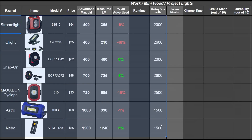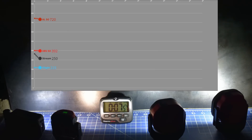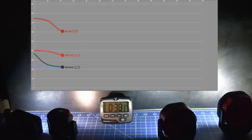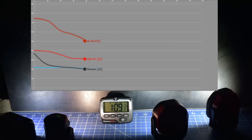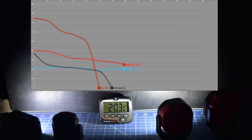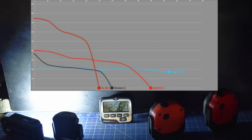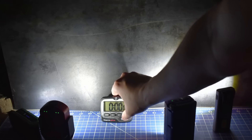Here's what the scoreboard looks like thus far. Peak lumens are great, but light output across runtime is what really separates the boys from the men. The Olight is on the left, then the Streamlight, then the two Snap-ons. The aluminum Snap-on starts out just over 700 lumens, then sharply dives and goes out just past the hour-and-a-half mark, followed by the Streamlight Cyclone ten minutes later. The 400-lumen Snap-on holds on longer, tapering off past two and a half hours.